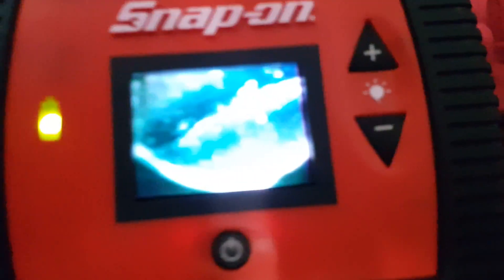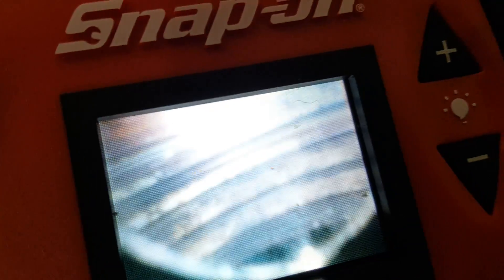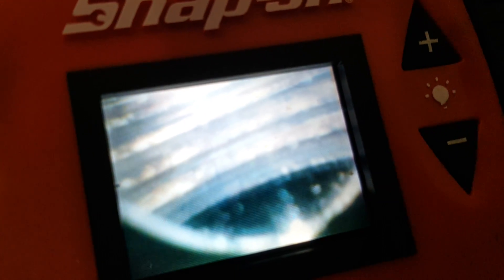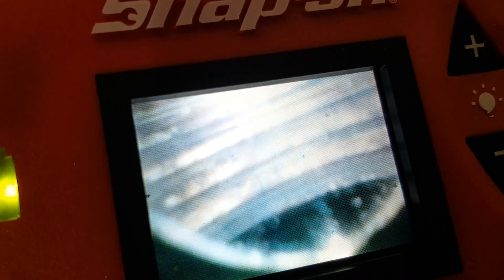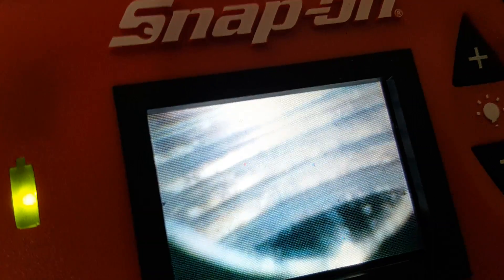Here's what I'm going to do to help you guys out — stick with me. Here's my bore scope screen. I'm going to put this thing down in here. What we're looking at right now is a picture of the spark plug threads that were cut by Ford with their machine. At the very bottom of the screen you see kind of a black space — that's the inside of the cylinder. We're counting spark plug threads from the cylinder outwards.